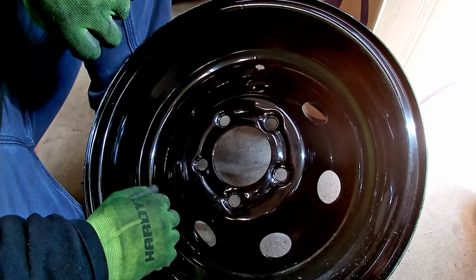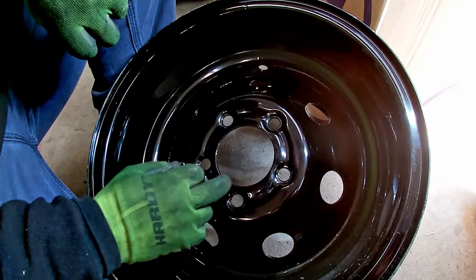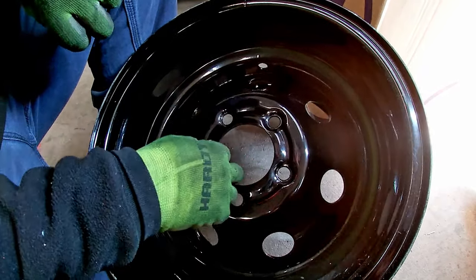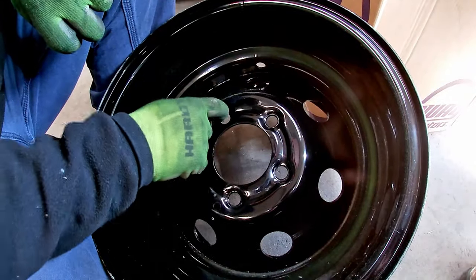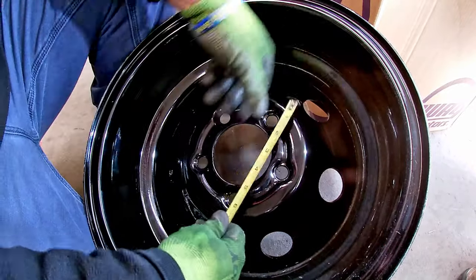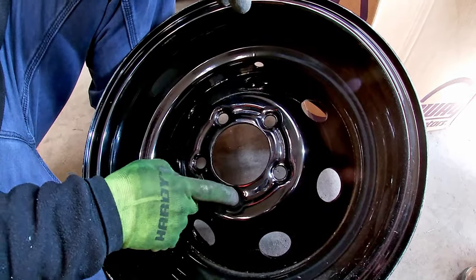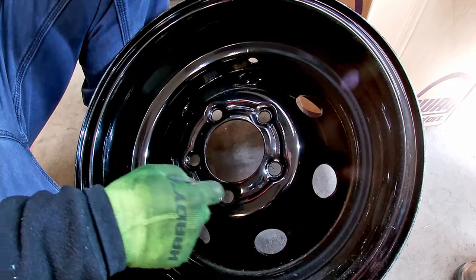It can be a little misleading sometimes when you're looking at one of them. If you're racing a 4-cylinder and you got 4 lugs, you measure center to center across, because the center of those is the bolt circle. But on a 5-lug, the center of the hole is not the bolt circle. That's why if you measure your stud from center to center and you say, oh, I got a 5-on-5, and you order a 5-on-5 wheel, it's probably not gonna fit. You got to measure outside to center of your stud, and if you do, it'll be really, really close.